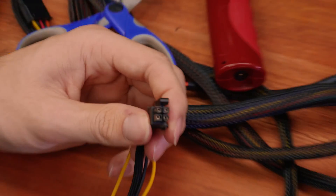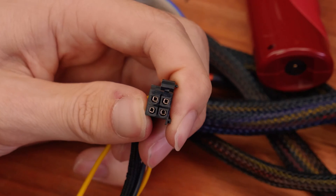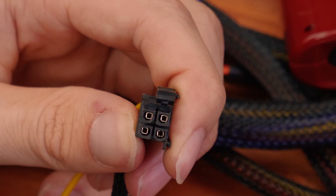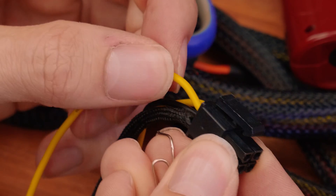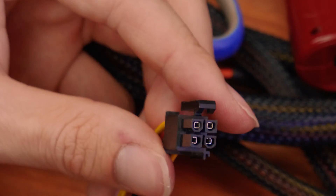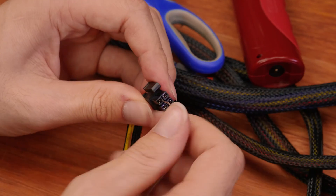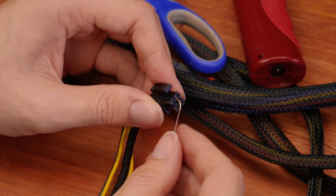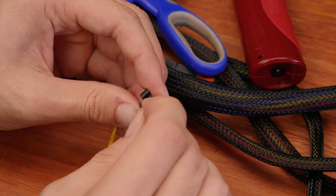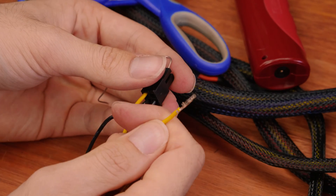On each side of the actual pin — if you hold it upright with the connector facing you — you can see the square little pins inside. On the left and right side of each square pin is where you'll have what I call the wings or the tabs, which you need to push back with your paper clip. First, make sure you push the connector or wire in, because some power supplies have a little bit of play. Then take your paper clip and stick it into one of the sides. It can take a moment to get that little catch — push it down as far as you can without too much pressure, then pop it out and push on the other side to get the other tab down. Then you can hold the connector, give it a tug, and the connector pops right out.